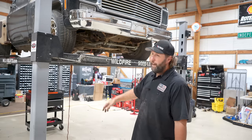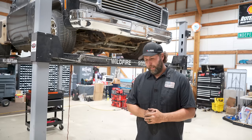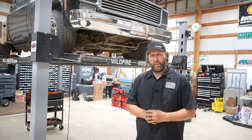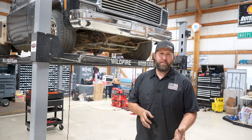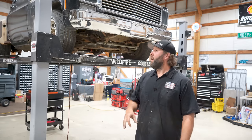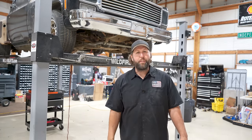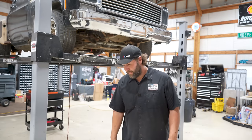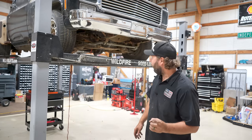So now I'm gonna drop it back down on earth here. I'm gonna loosen up the headers, probably take the spark plugs out. I don't wanna break them, I'm gonna try to reuse those. Probably take the fuel pump off so I get better access to the motor mount bolts, which is next. And once that's done, we can start talking about, you know, the cooling system, the hoses and the doodads and the digicals and all sorts of stuff. But we're getting there, we're gaining ground.